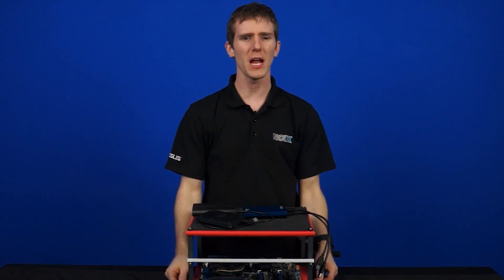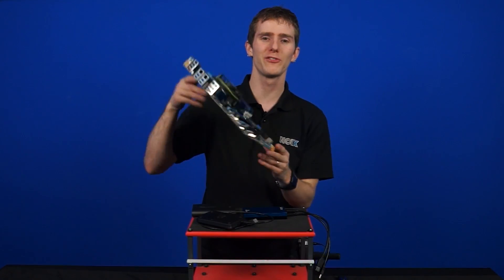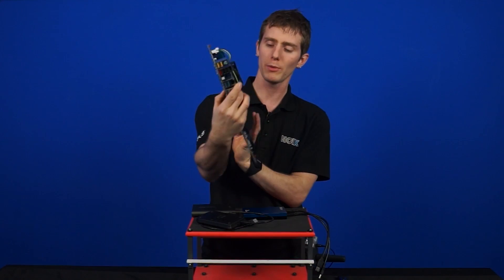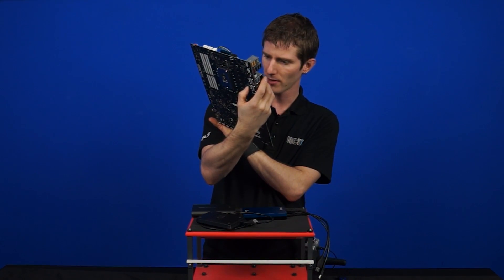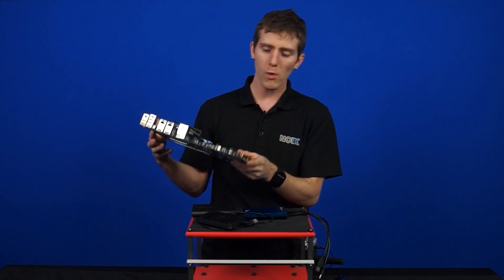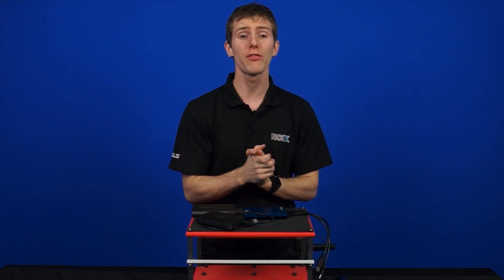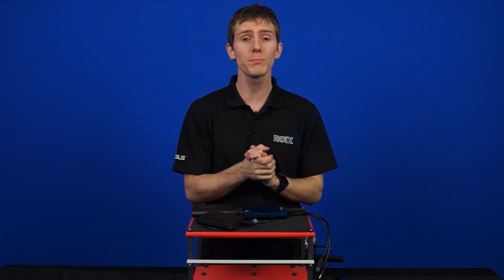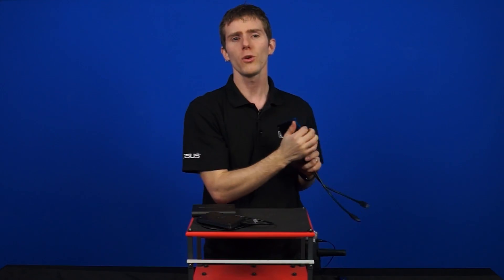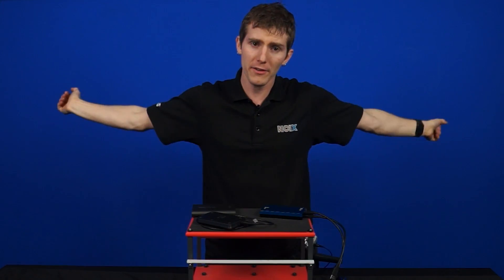This is Wheels' test bench. He's got a bit of an older motherboard simply because we had a tough time finding a Thunderbolt motherboard around the studio. It's an Intel desktop board — fun fact, this is basically Intel's last high-end motherboard because they have exited the motherboard market. One thing we discovered during the benchmarking process: USB 3 extension cables can throw your numbers and performance for a loop. For best performance, always plug directly into the back of the motherboard and directly into the drive itself. To test all these drives, we used the Blackmagic Disk Speed Test, CrystalDiskMark, and ATTO.